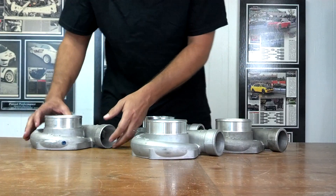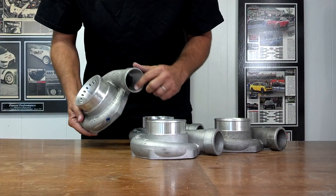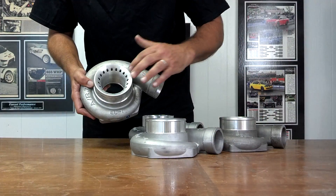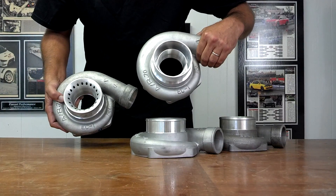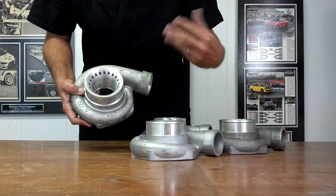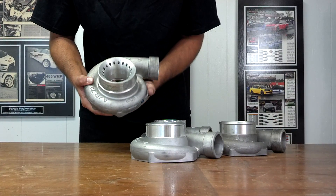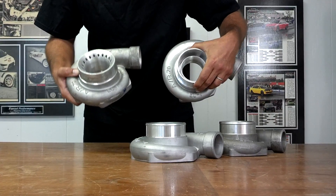The last one I have here on my right is, well, it's really pretty. You can see it's got nice machine work on the inside of it. But this pretty machine work doesn't make up for these holes drilled here. You have the same column of air coming in, you have the bell mouth from the old-as-dinosaurs type cover, but you have these holes drilled here. Now it is a lot simpler to drill these holes than it is to mill out all that material — expensive machine work versus cheap machine work. But the big problem is while these holes look like they're doing something, they don't really do anything. These holes do not present enough area to the column of air coming in to actually get any flow to go through the surge port. You can run the turbo with this cover and make more power with an open cover than you will with this bullet hole cover.